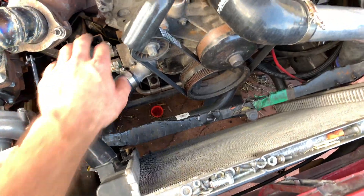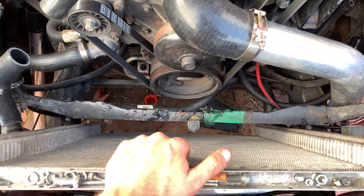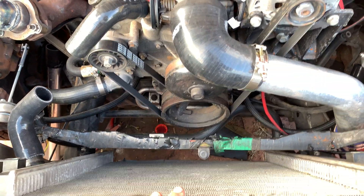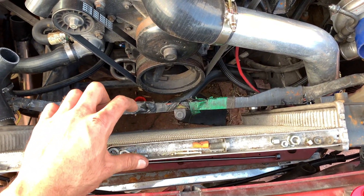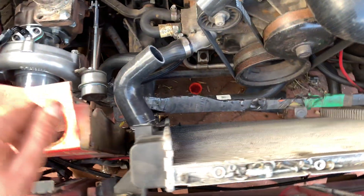There's still miscellaneous wiring to do, and obviously this tube and the fan. This is the stock radiator — I cut the support and leaned it forward. The other setup was just too big, too much of a mess. This works out, and if I need a thicker one I can get the Explorer radiator which is double the thickness.